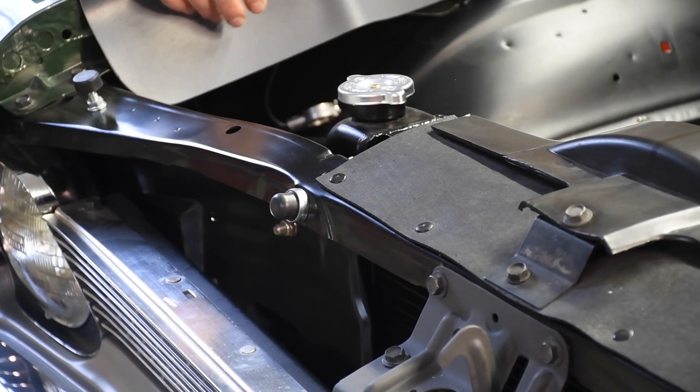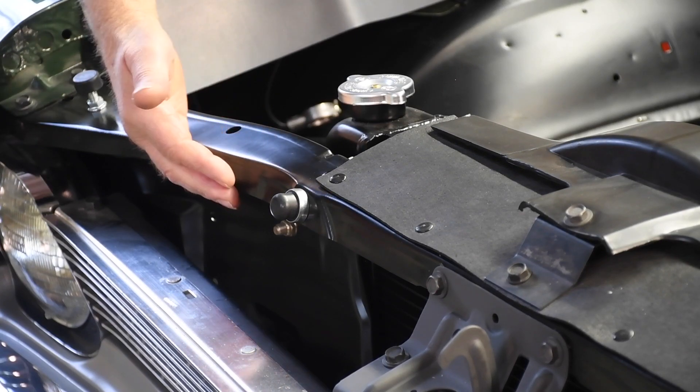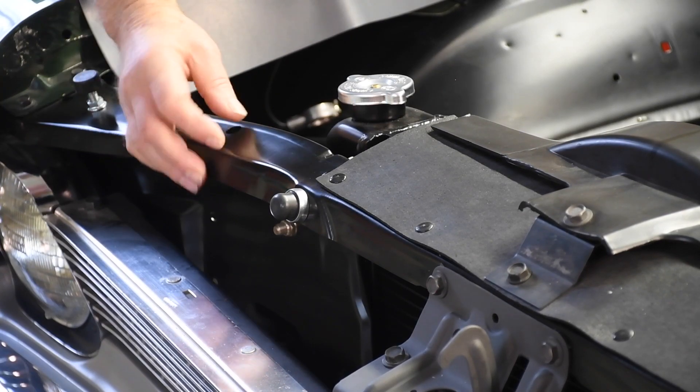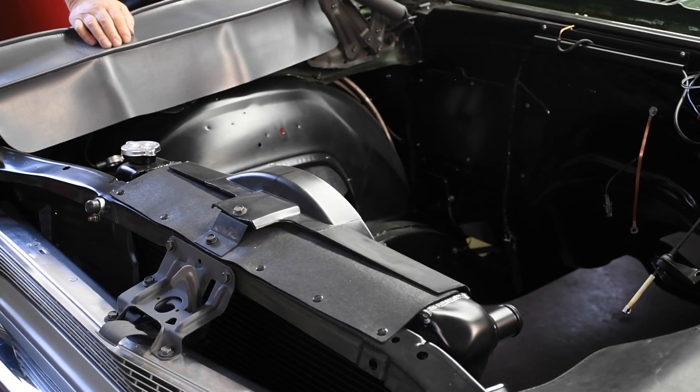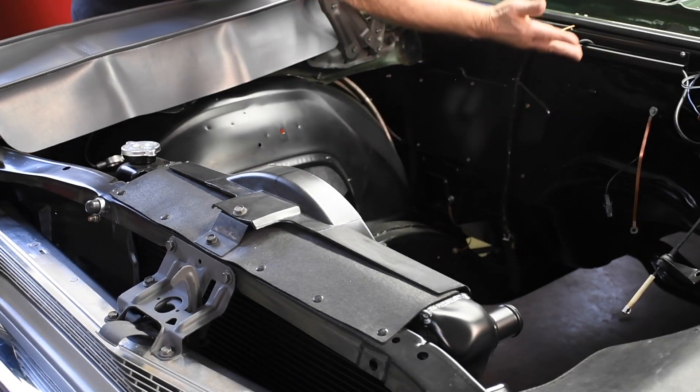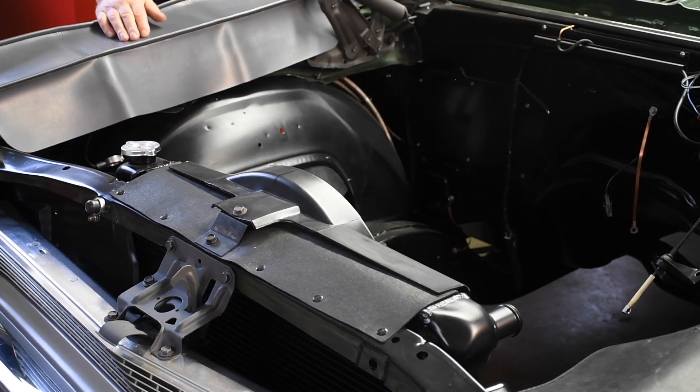When picking a spot, make sure it's located where you can't accidentally lean on it when working on the car — it's not like if it was on the top here. In something like a pro stock car, you'll often find one switch on each side of the engine, usually on the firewall, on the passenger side and the driver's side. And in a lot of cases you'll find one switch underneath the car near the clutch inspection hole in the bell housing.